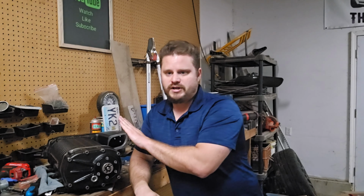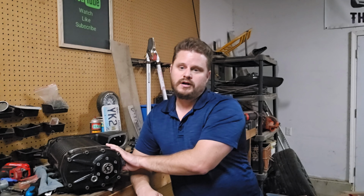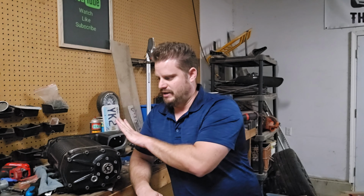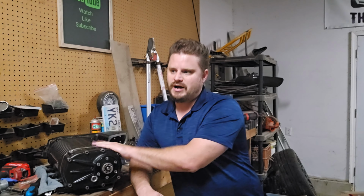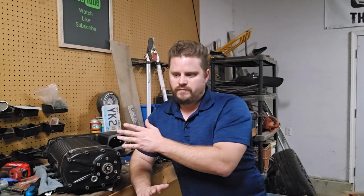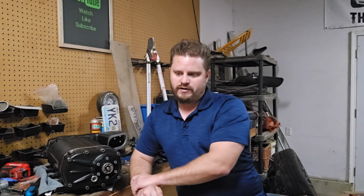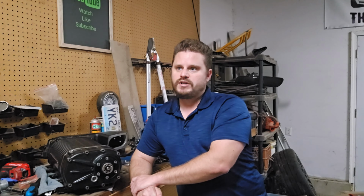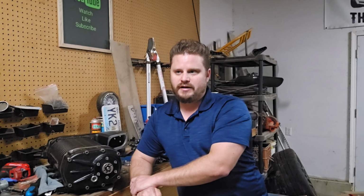But like I said, this blower has been awesome. It is an awesome blower, but I think it demands a built motor, demands a lot more. So at this point, it's either the 3.0, I go down to the 3.0, which I've done some digging and investigating with as well. It really just seems like that blower was built with the Coyote in mind, like high revving. You know, it sees a lot of good power up top.